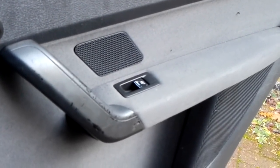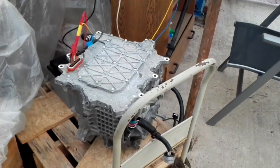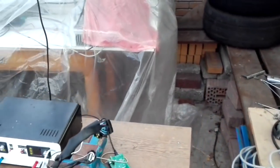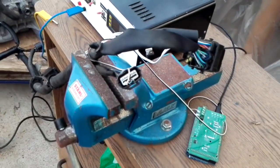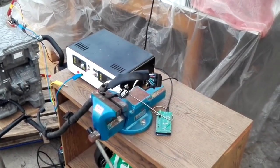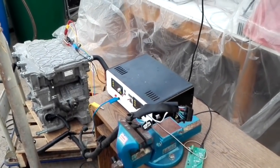Let's take a look at what we're going to put inside. Not much of a surprise — it's going to be the Nissan Leaf electric motor. As mentioned in some previous videos, this is also fully controlled via CAN, so no traditional I/O lines. Just two CAN high, CAN low cables for full control. And if I'm lucky, I can just use the existing messages on the CAN bus to control throttle and various I/O. We'll see.